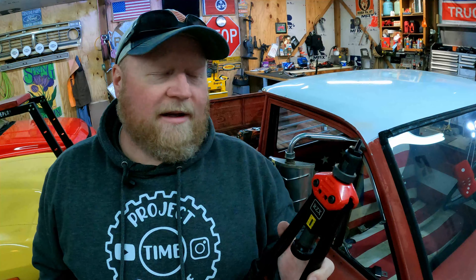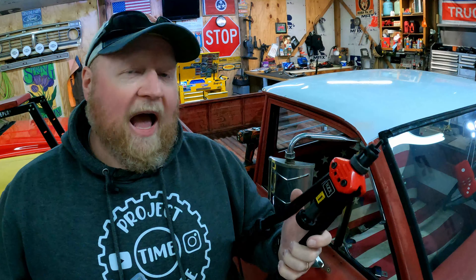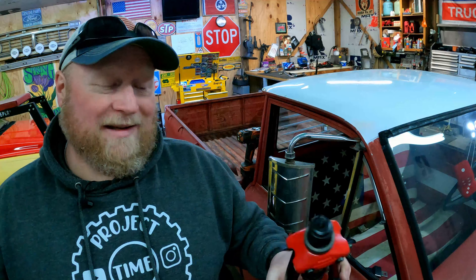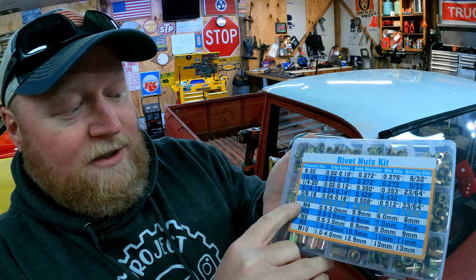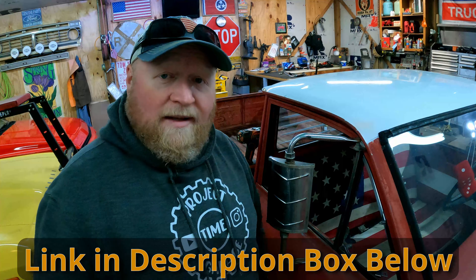If you do work like this and you don't do a lot of it, the more inexpensive rivnut tools on Amazon will do you just fine. I'm going to leave a link down in the description for this tool if you guys think you may want one. This one has worked really well for me — I've had it quite some time and used it a bunch. I'm a hobbyist, not slamming a thousand of these in a day, so this thing is going to hold up for the rest of my life, hopefully. Also, there is a kit of rivnuts covering 8-32 to 3/8-16 on the Imperial side and M4 to M10 on the metric side. That covers just about everything I've run into in this garage. I'll include that link down there as well — it's a pretty cheap kit, real cool to have in the toolbox.